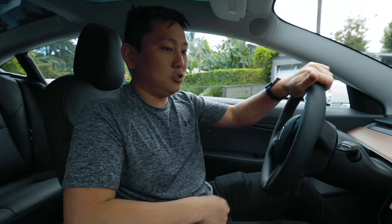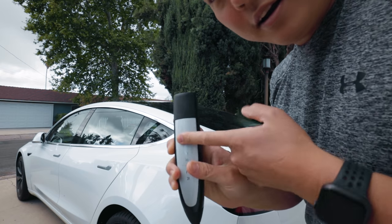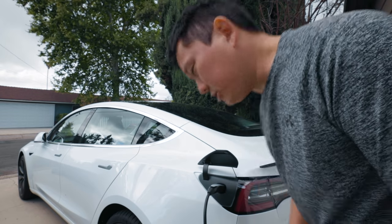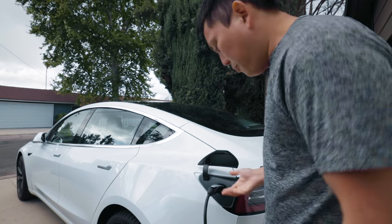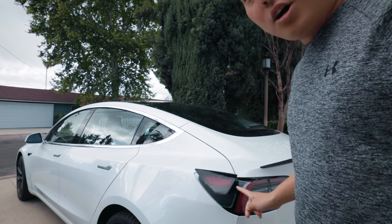We actually have the slowest charger — the one that comes with the car — which plugs into a standard household socket. It's not super fast but not terrible. To open the charging port, my favorite way is to put the charging cable near the port and press it — it automatically opens. A blue light means it's ready to plug in. It flashes while connecting, turns to flashing green when charging, and solid green when fully charged. The red light means something is wrong. When it's charging, the cable stays locked in to prevent unauthorized removal. To remove it, the car needs to be unlocked or your phone nearby, then press the button to release it. You can also press on the bottom of the port to pop it open when the car is unlocked.